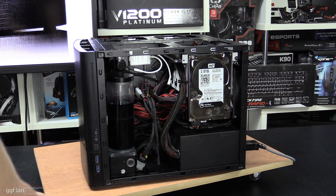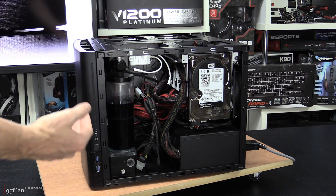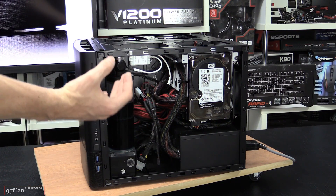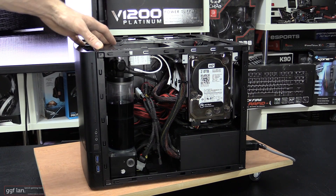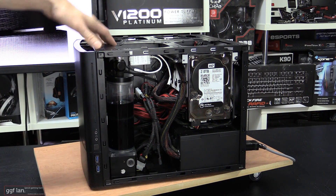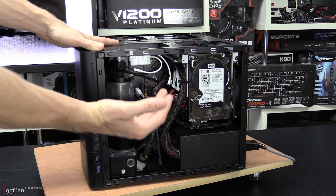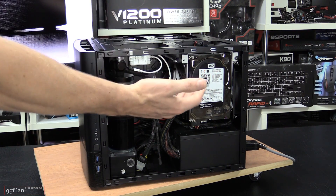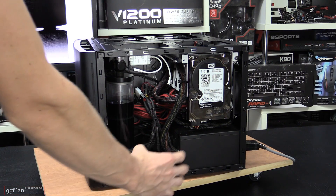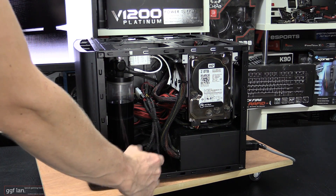Here's the other side - it's a little bit messier. I've got one hard drive cage in; this is where the other one could have gone. If I used a smaller reservoir I probably could have got the other hard drive cage in and nearly got the eight spots. Or if I wanted better water cooling, I could have gone with a smaller half-height reservoir and got another radiator up the top, providing I didn't need as much storage. Most of the time you probably don't need eight terabytes in a system like this. If you're using it as a gaming rig you could go for more water cooling; if you're using it as a home theatre PC you could have the larger storage. There's plenty of room for the power supply - you could probably fit a larger 1200W unit in there quite easily.